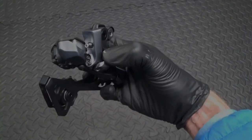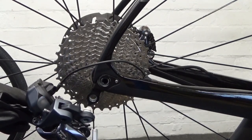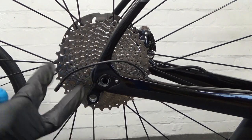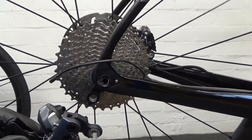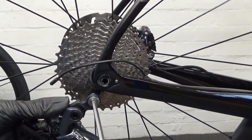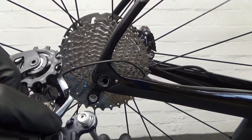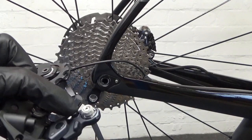Using your 5mm hex head to screw it to the derailleur hanger, put some anti-seize on the thread before you screw it in. You can see we've already got the wire coming out of the frame ready to mount. When screwing this on to the frame, make sure that the tab sticking out on your derailleur hanger actually hits the tab on the derailleur — make sure they're actually touching one another when you're tightening up.